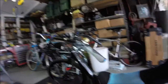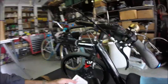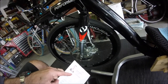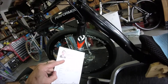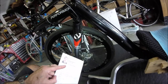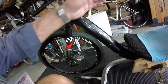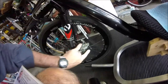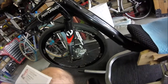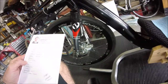The brake adjust — this is my first experience with disc brakes on a bicycle, and I really like that they're not hydraulic so I don't have to deal with that maintenance. These squeeze the pistons from both sides. To adjust them, I just pull the lever with the mounting bolts loose, let the caliper center itself, then tighten it down and release the lever. That's all I've ever had to do to keep them from rubbing. I'm very happy with the disc brake option.